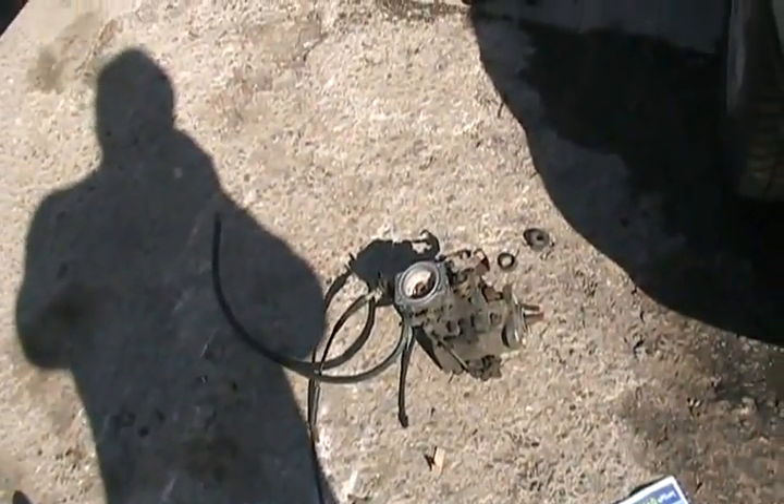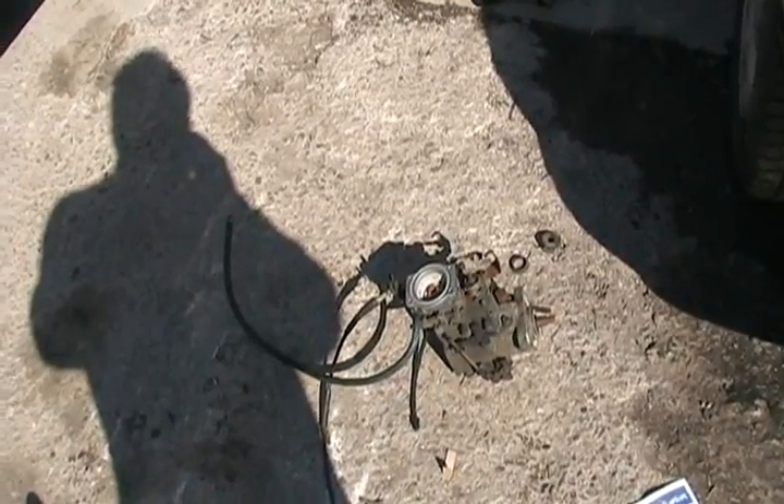Luckily I got a no-good pump that someone donated — it's all rusty as hell — that I can use as reference in case I forget. Well, now I got that injection pump all put back together. Seems like I got lucky. I didn't mark the little line that's on the throttle shaft to the throttle lever to synchronize it, so when I put it back together, well, I must have got lucky somehow because it seems to be synchronized.